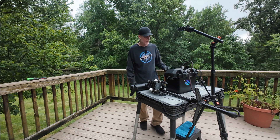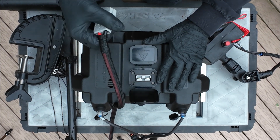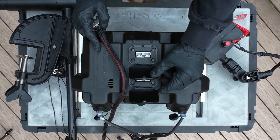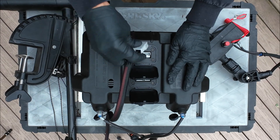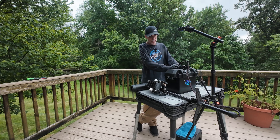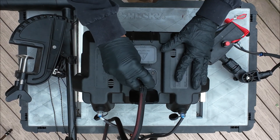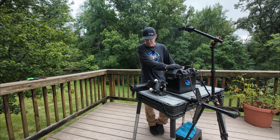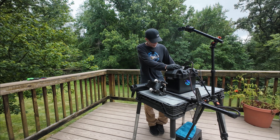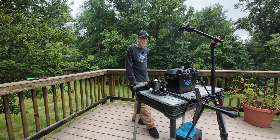One way I can prove the motor isn't damaged: say I'm out in the field and the pulse width modulator takes a crap — I can just plug in this Anderson connector, which bypasses the PWM completely, and there we go — 100% speed. If I'm on the pulse width modulator and crank it all the way up, I'm getting full current but something still isn't right. I think maybe the potentiometer is bad. But either way, this is exactly why I have not made this video — it's not reliable.